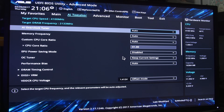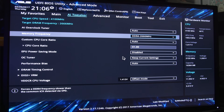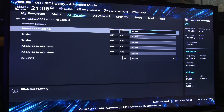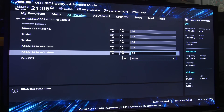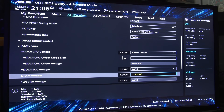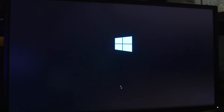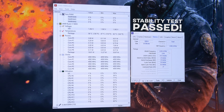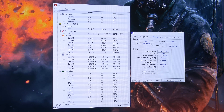Let's mess around with memory now. Let's do 2666 MHz, which is the highest rated speed our motherboard supports. Timings are 14-14-14-34, and we'll change the DRAM voltage to 1.35. We booted! We're running at 1330.6 MHz, which multiplied by two gives us 2666 MHz on the DDR4 in dual channel. So our final score for the B350 platform is 4.1 GHz on the core with a 0.0375-volt offset and DDR4 at 2666 MHz.